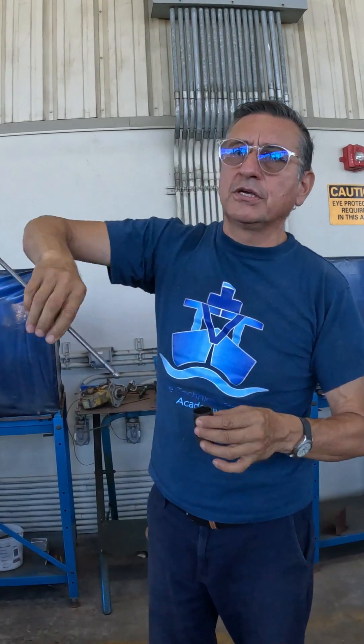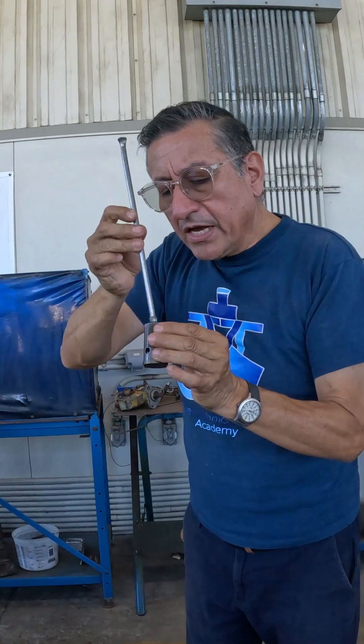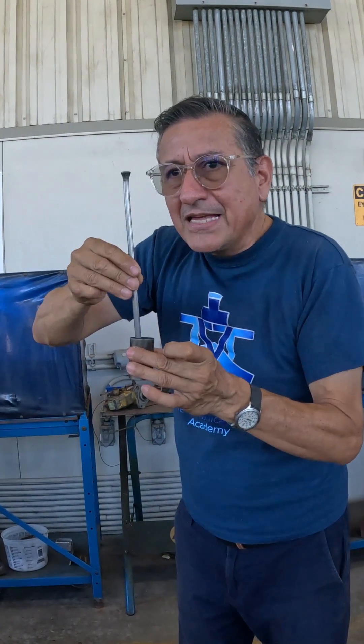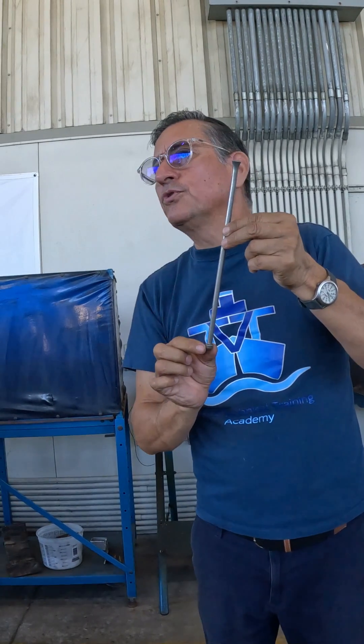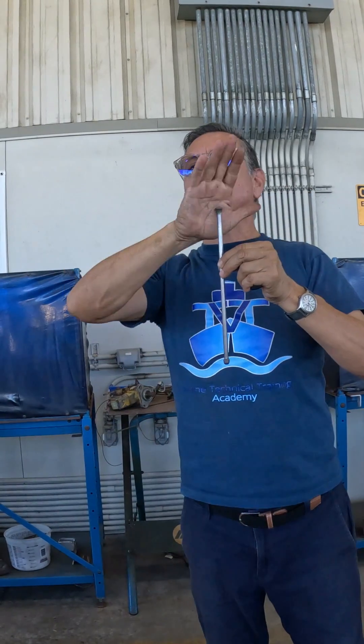In this hole I have the push rods. You see that the push rods have this conic area — this one entered in the bottom exactly like this. The majority of engines have those push rods hollow, which means the oil goes up and lubricates the rocker arms.